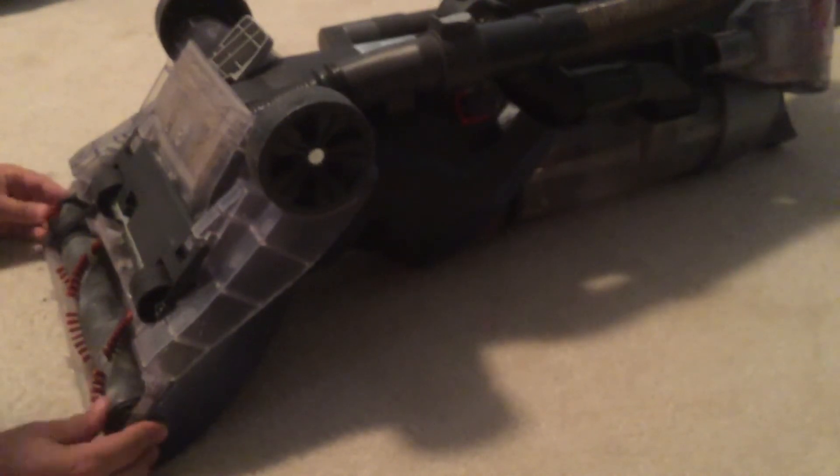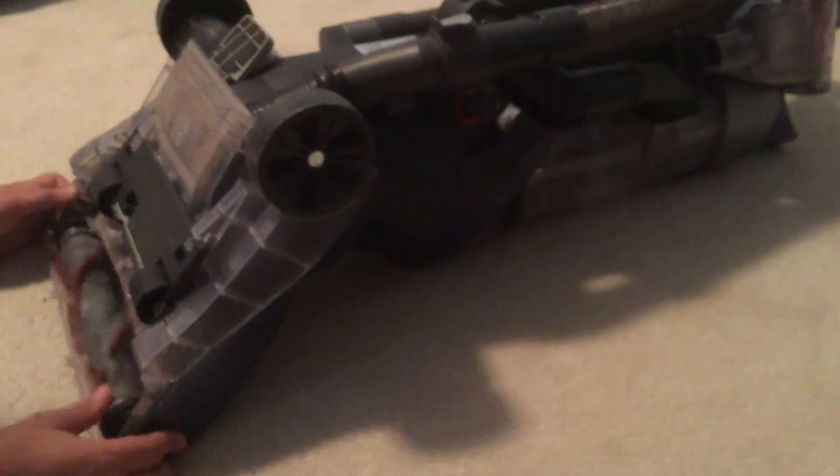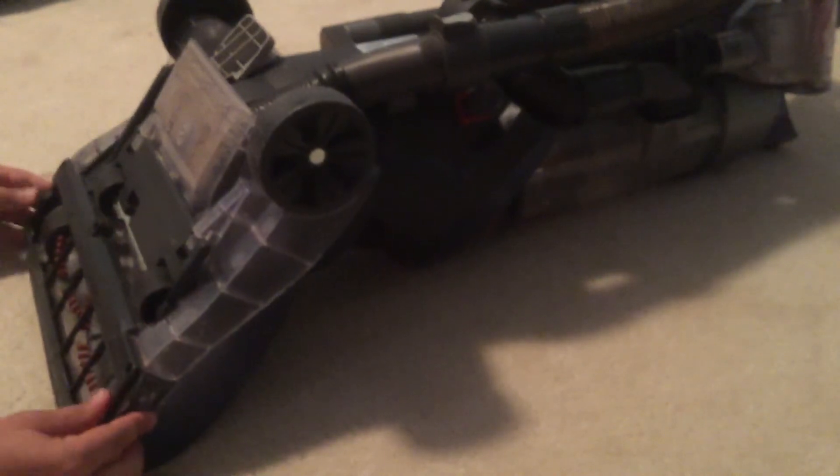You're going to have to put a little force into it. Both grooves are lined up — make sure it's straight and that the brush roll can function, that it spins freely. Now put your cover on right here, snap it, and screw in from one to six.